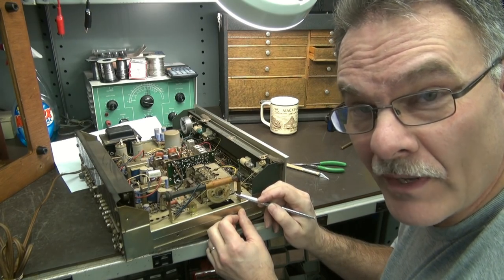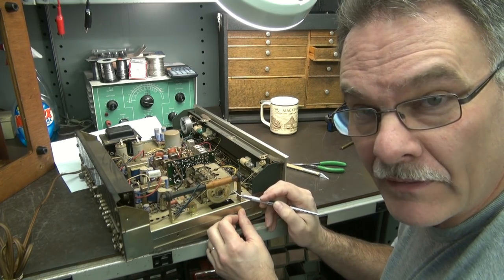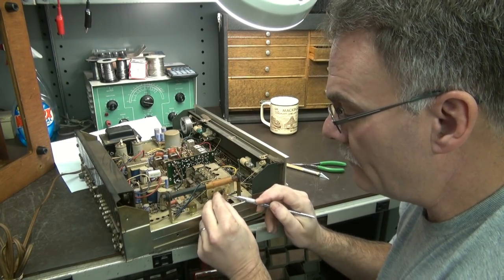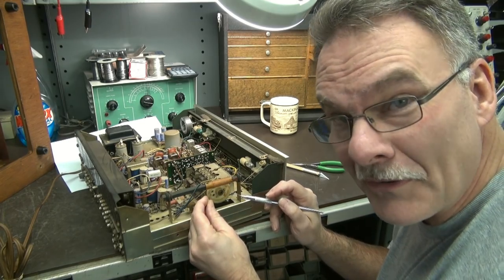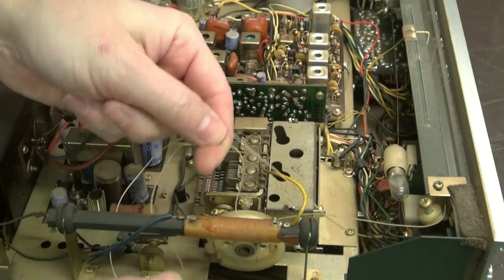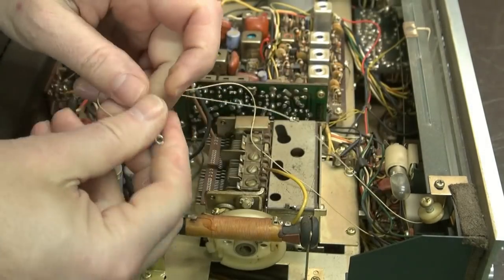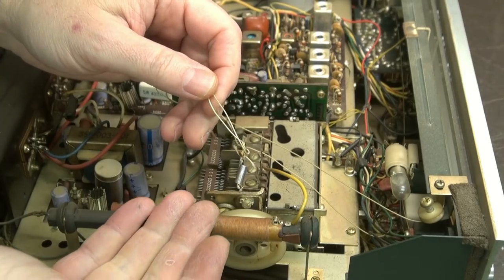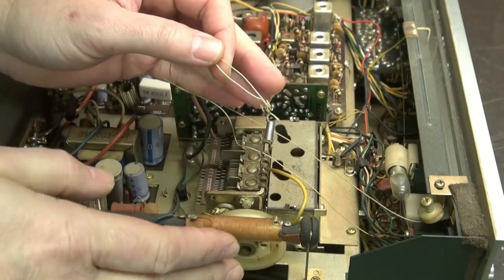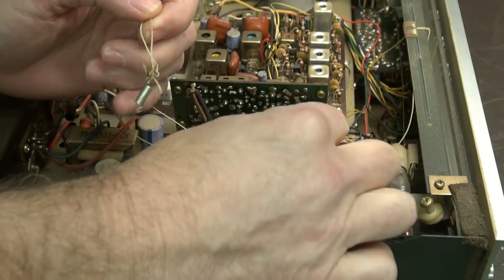I have the retaining spring off of this little tab on the pulley — you've got to be careful. They put glue on that and it really holds it. If you take something and just pry it, you're going to break that tab, and if you do, you're hosed. So take your time and get that baby off. Now I'm at that point of no return — I've got to pull off this string and get her measured. Just kind of get it unlaced out of there. The only other piece of advice I have is don't take this all apart and come back in a week — do it on the spot while you still have it fresh in your mind, or you're going to have a disaster on your hands.